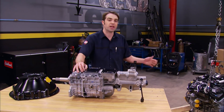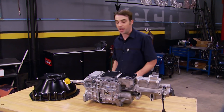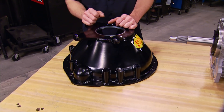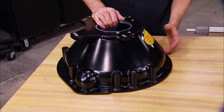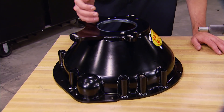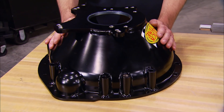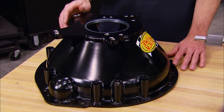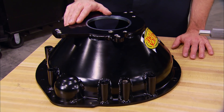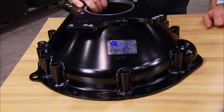With our engine's big fat torque curve, we won't have to do a bunch of shifting to stay inside the power band. To attach our transmission to the engine, we're using a QuickTime bell housing made from high-strength steel — twice as strong as your typical steel bell housing. It's got laser-cut flanges, is spin-formed and CNC-machined, designed to be the lightest, strongest, and most accurate steel bell housing available. It's also SFI certified for those doing racing.